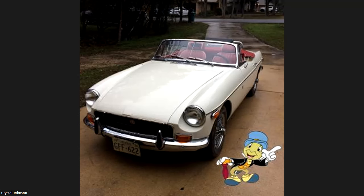Let's see. Possibilities include the brake shoes moving, the pads moving, the caliper moving because you didn't get the bolts tight. So the caliper is actually shifting on the stub axle. I don't think it's the bottom of the stub axle loose against the A-arms. You should see what you can do. If you've got two people available, have somebody put more and more pressure on the brake pedal and move the wheel, just listening and trying to feel it. You shouldn't hear any noise when you're braking like that. I'm not sure what it is, but you don't want it there. It's a harbinger of something, like, oops.